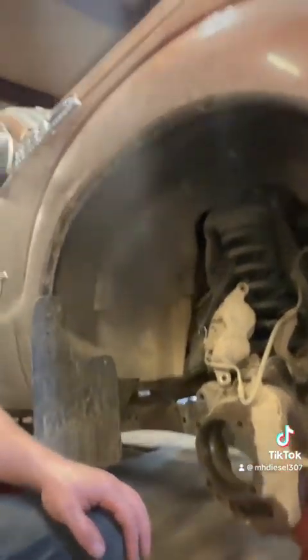I'm going to go ahead and pull that ring gear and carrier assembly out and change out the axle shaft seals and the tubes. The customer said it feels like the rear end has a lot of driveline slop.